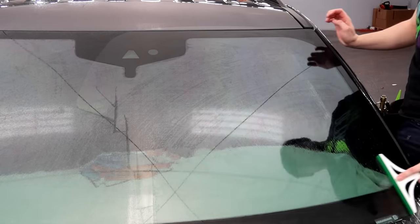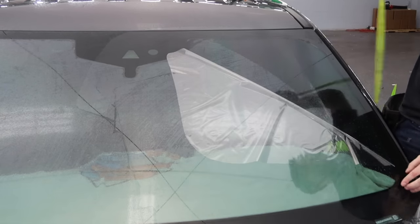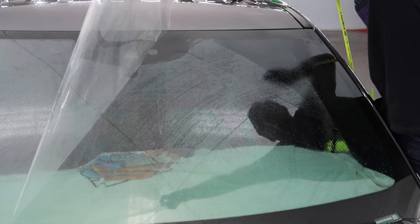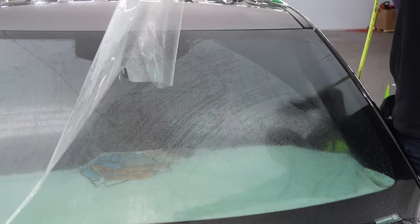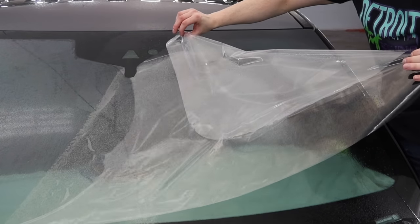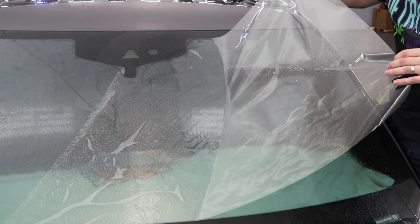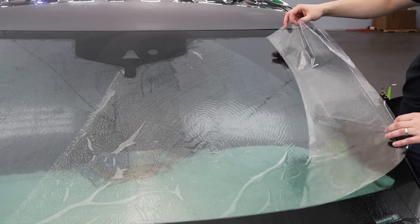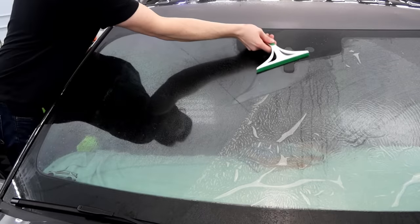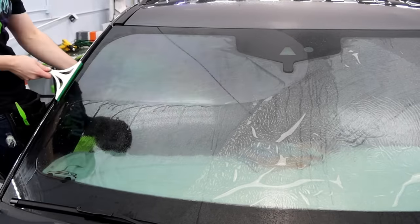I'm taking a big flat squeegee — this is a Libman squeegee. I first squeegee half of the windshield, then I'm going to peel the liner about a quarter of the way and pull up the other side. This way the liner doesn't flop all over itself. It's very direct — kind of like origami — so the film isn't flopping all over the place and introducing a bunch of dirt. Then I'm going to spray the film and get it to lay back down as smooth as I can. You don't need all the air bubbles out, but you want it at least laid on top of the film you just peeled.